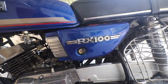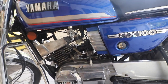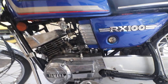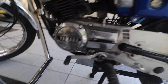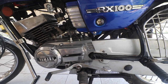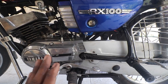Check the date on the battery — if the seller has a warranty card or proof of purchase for the battery, that's a good sign. Turn on the fuel and check if it is leaking — if it is leaking fuel, you will have to open the carburetor and adjust the float height. Also don't hesitate to go under the bike and look: there should be absolutely no oil under the bike. A person who keeps their bike clean is likely to maintain it well. If there is oil coming out, you may have to address some issue.